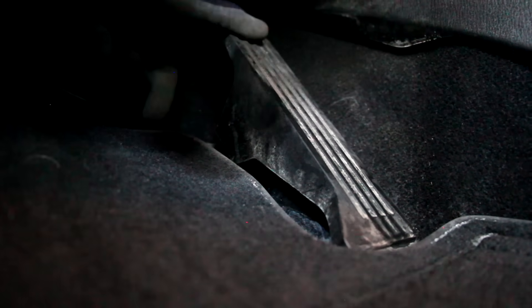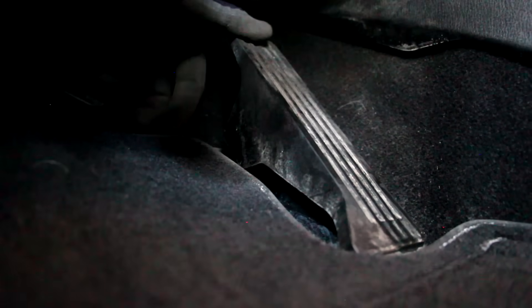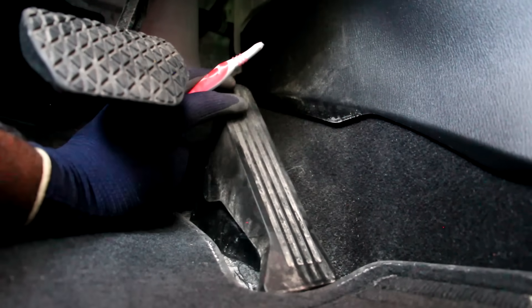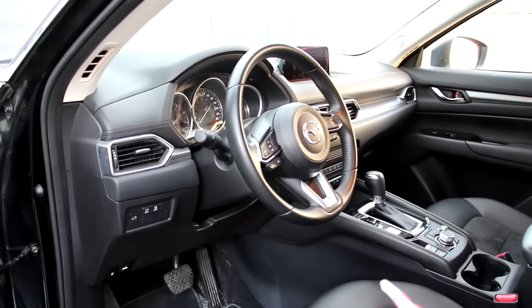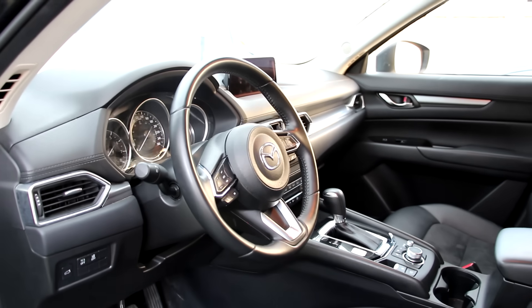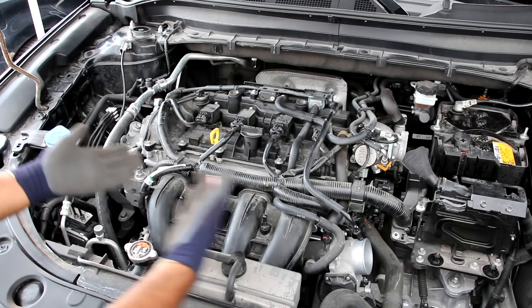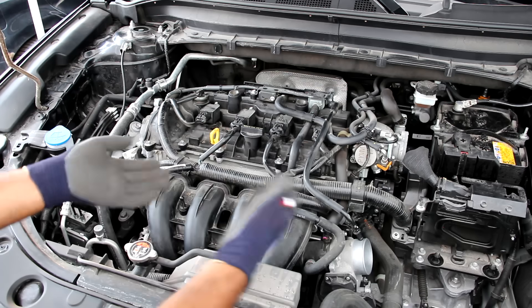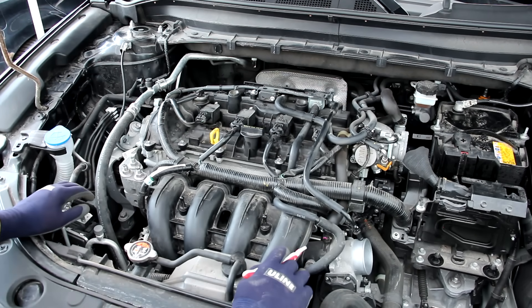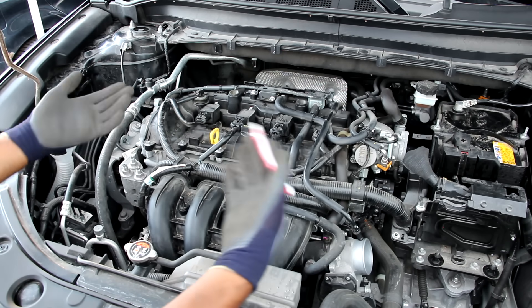The power steering system on the CX-5 uses an electric motor mounted on the steering column underneath the dashboard away from any elements. You might not know why your gas pedal clicks when you hit 100% throttle — it's there as a tactile feedback to the driver warning them that they've actually hit 100% throttle. There is no electronic button or kick-down function that happens when you hit that. Overall I think Mazda's done a pretty good job in terms of build quality and material choices, especially in the interior, where there's enough technology to fool you into thinking this is a really good SUV. However under the hood Mazda's taking more of a traditional tried-and-true approach by using older technology such as a naturally aspirated engine and a six-speed automatic transmission. A lot of its competitors have a lot more technology under the hood at this price point, however this is going to work well if you want to keep this vehicle for a long term because its simplicity lends to its reliability.